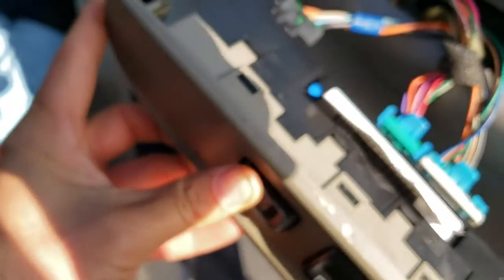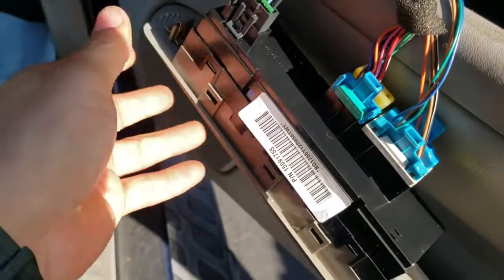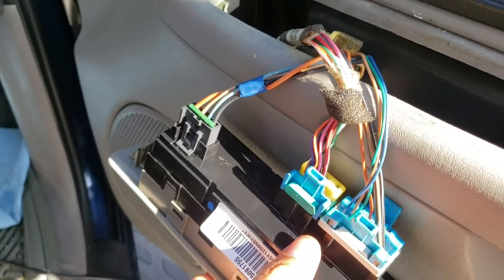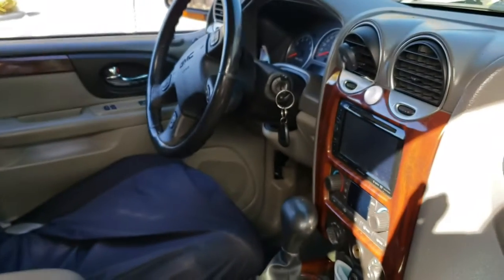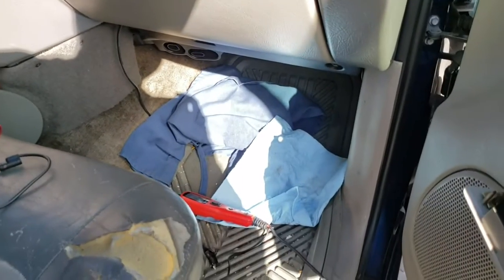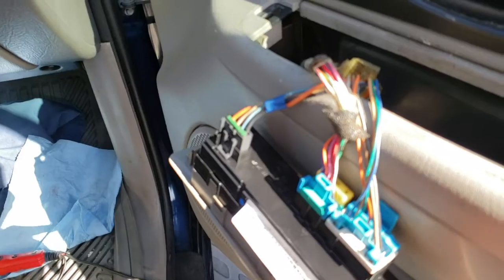At this point, because everything is working, I cannot demonstrate what I wanted to show before, because like I said, it started working when I pressed on here, and I cannot reproduce the condition because everything went back to work. So I just press on the board here. But I will demonstrate how the link wire communicates, because I didn't know at that point if this switch was bad or if the switch on the driver's side was not sending a command for communication, because these are basically both computers. So we're going to demonstrate that with the picoscope.